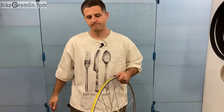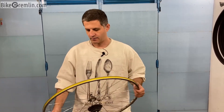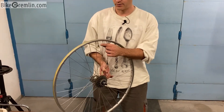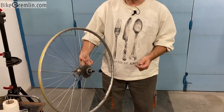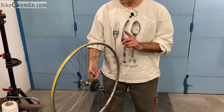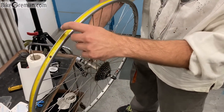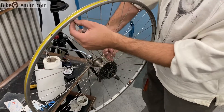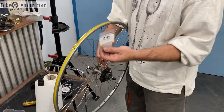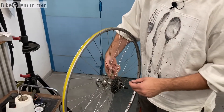What I will try to do in this experiment is leave all the spokes on this wheel as they are. I have marked one spoke which I will try to put under a lot of tension and see if I can get it to break, and how — whether on the thread side where the nipple is, the elbow, or somewhere in the midsection. To make this work, I have used a nipple washer to distribute the load over a wider area on the rim so the nipple doesn't get pulled out. I've greased the interface and spoke threads well and added the nipple washer.